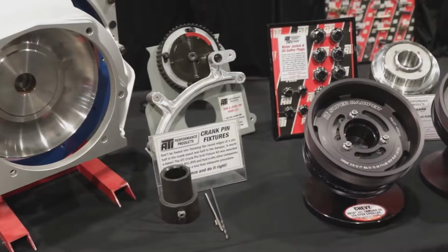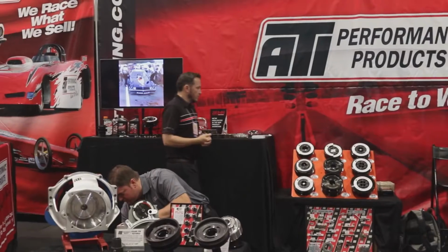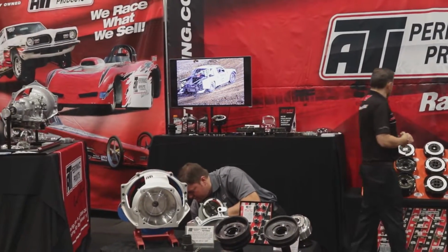In modern muscle cars, we have 6, 8, and even 10-speed transmissions. But the thing to remember is a lot of that is done so the OE manufacturers can get fuel economy and things that hot rodders don't have to think about. So it's pretty much a misnomer to think that you need 10 speeds. 4 is fine, right? 4 speeds is fine? The guy that's drag racing, which is what we do, we do drag racing for 99% of our business. A nice 3-speed transmission, I say 4, you get 4 with overdrive, but a 3-speed gets you from A to B all the time, and it is fast.